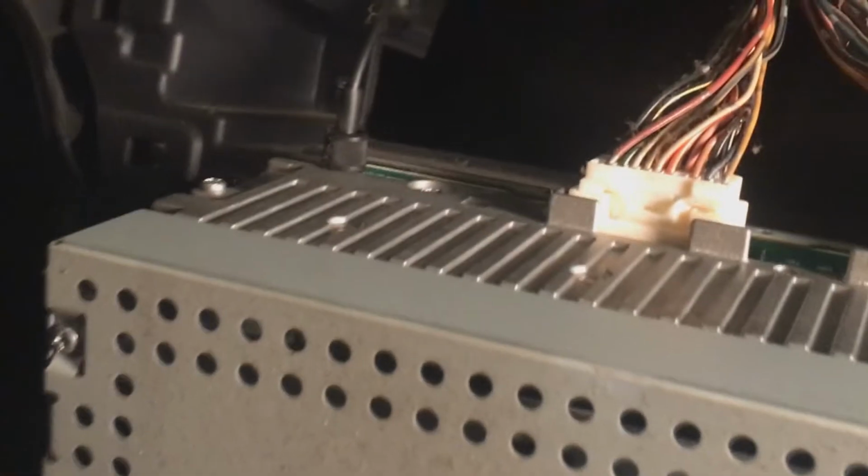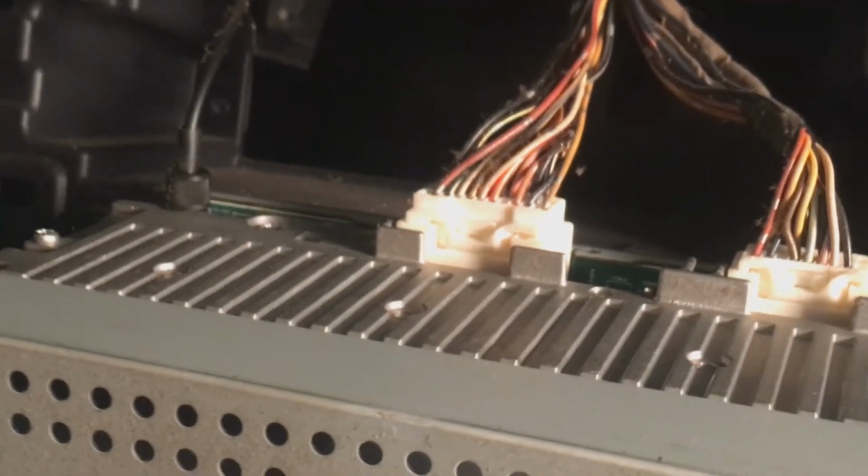And yeah, I'm gonna go ahead and bring the wiring harness I have and just compare it and see which one it goes in, and we'll go from there. So I'll catch you guys in a few seconds. This is the one that came with the radio. This is the harness for Mitsubishi. So these are just gonna go like this with each other, and then this part will plug into the radio and this part will plug into the car. So yeah, that's about it.